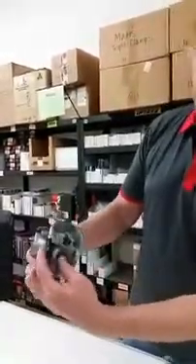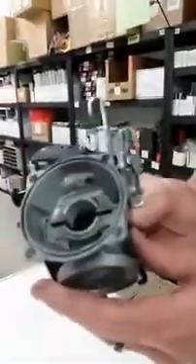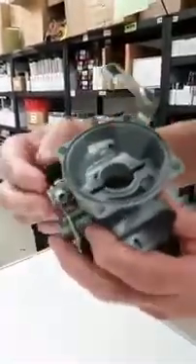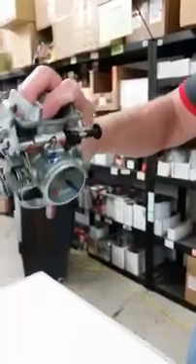One of the other things — with the choke cable attached there, there's a little choke window. When you're activating the choke, you'll see the little brass plunger pull aside. It's closed, it's open again, and that's where the fuel flows in. It comes out through the blue vein right there — that's going to be the airflow for the choke circuit. Again, the choke will pull fuel through that little orange hole right there.